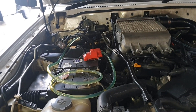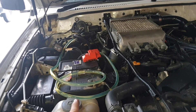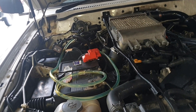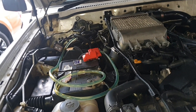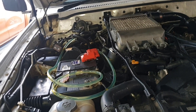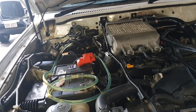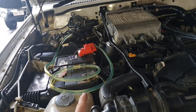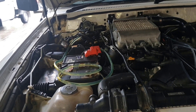I'll show you what I've got hooked up and the things I go through before doing the injector bottle test, and we'll look at the results. One of the first things you're going to want to do with a common rail complaint like this of long crank is hook up some clear hose. I've got that going from the fuel filter to the fuel pump itself. The idea being if we had some kind of leak in the vacuum feed system up to the pump, as the car sits, that's going to give it a chance to have the fuel revert back to the tank and you're going to have to suck that up. So we want to leave it sit and make sure this stays full of diesel, and then also while it's running you can easily do the test of seeing that there's no air bubbles in there.